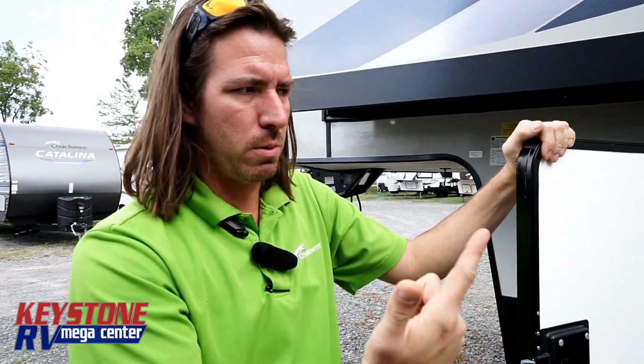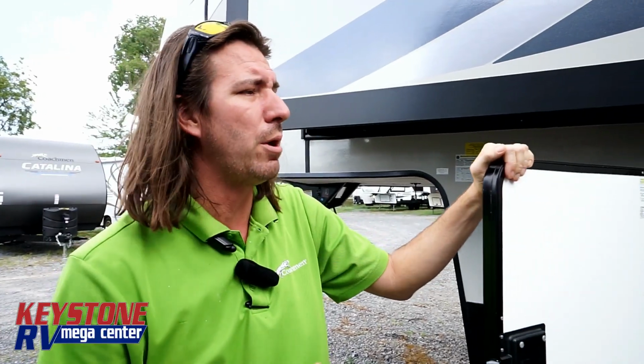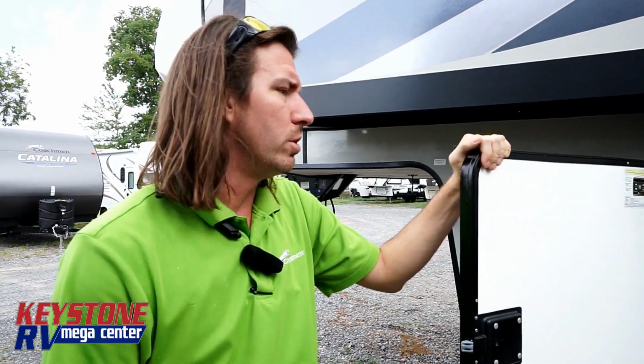So, make sure we're powered up. Make sure we're not walking around. Make sure we're not asking too much of the jacks. If you're doing those three things, that'll remove just about all the error codes that we do see.